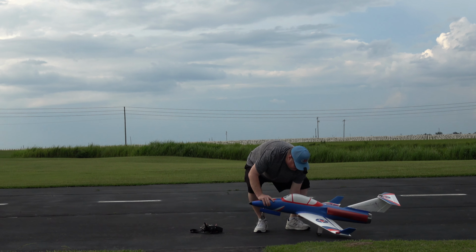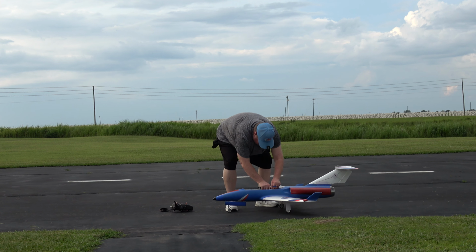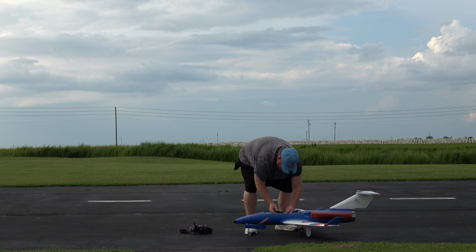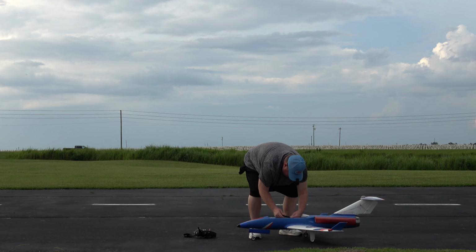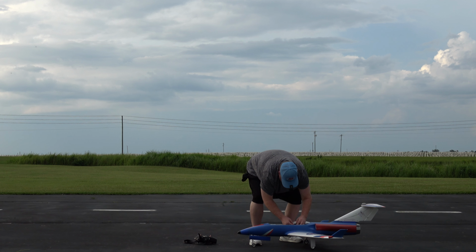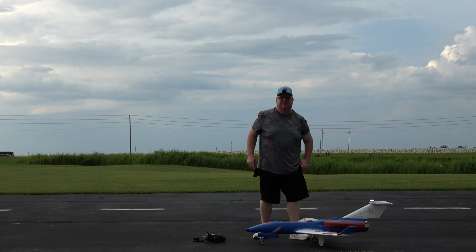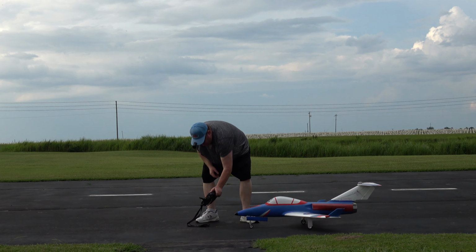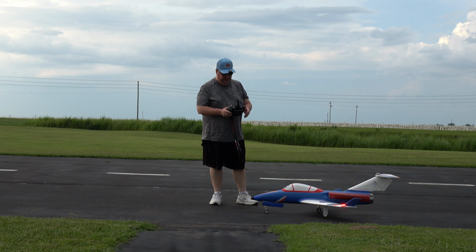Oh, wait, you know what we didn't do? We flew hard for 3 minutes and 10 seconds. We didn't see how much juice is in the tank, did we? I mean, I had a lot of landings and takeoffs and full speed passes. Let's see what kind of juice we got in the tank. Hold on. Get my battery checker to work here. I got 44%, so that's perfect. So if I was due for, say, 3.5 minutes, probably come back at about 25%. So really 3.5 minutes. Gotta remember, this is an older EDF, an older model, so not as efficient as the new ones. So 3.5 is as much as you want to push it. And that's on a 5000.